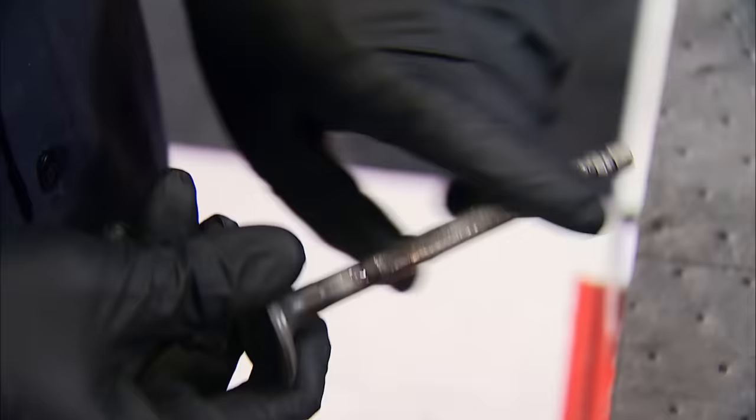It needs to sit as close to the rotating parts as possible, but still have a small air gap for part expansion when up to temperature. This one fits pretty good out of the package, but isn't as close to the counterweights as we'd like. By slotting these holes a little bit, we can move the entire wiper inward and close the gap. A steel burr works great — just let it do the work. Use a vise or risk the burr catching the part and injuring your hand. A little silicone between the pan rail and the wiper will seal it up the right way. Power gains from this mod vary from 2 to 3 horsepower on mild performance engines to 7 to 10 on high-RPM race engines. Plus you get better oil control, less rotating mass, and it reduces oil foaming on the surface. Not a bad upgrade for 25 bucks.